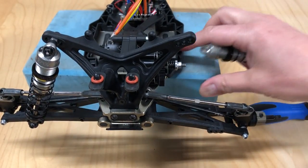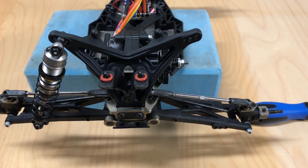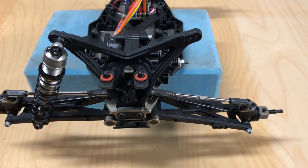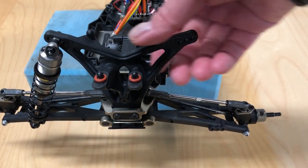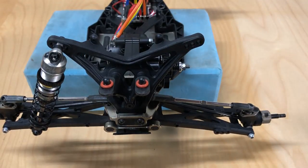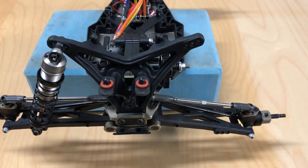That's pretty much it for shocks and explaining what moving them around actually does. A lot of material just says move it in for softer, move it out for stiffer — but it depends on whether you're talking about the arm or the shock tower, and you're also affecting the progressiveness as you move it around. Hopefully this video is entertaining, useful, and informative. Throw down a comment below if you agree or disagree. It's really just a lever — the arms are either moving up to the shock tower or the shock tower is moving down to the arm. Please like and subscribe to my channel if you haven't already. Take care guys, bye.